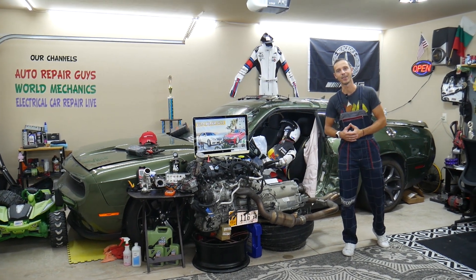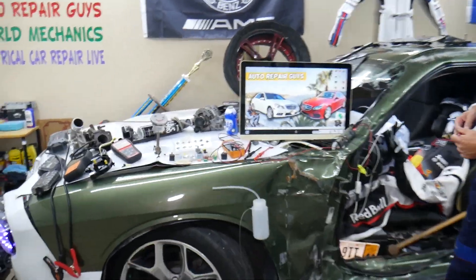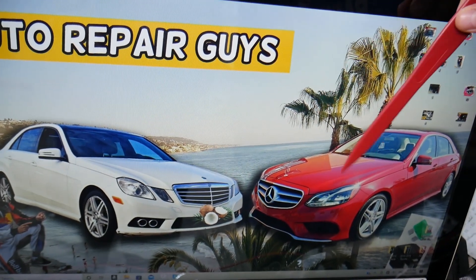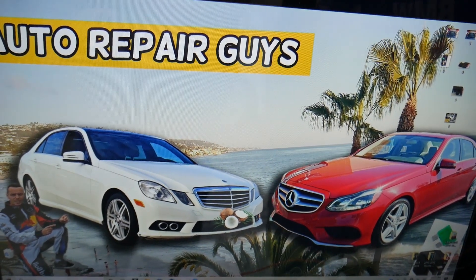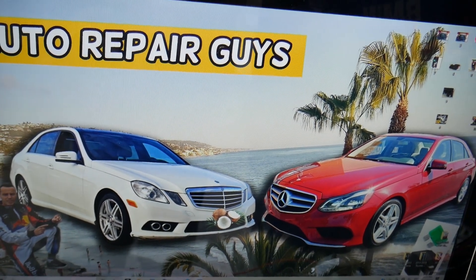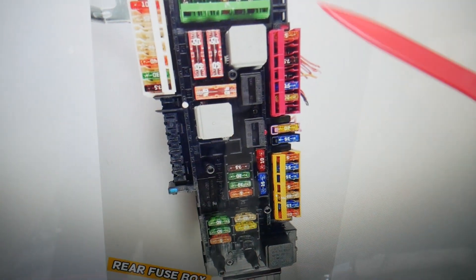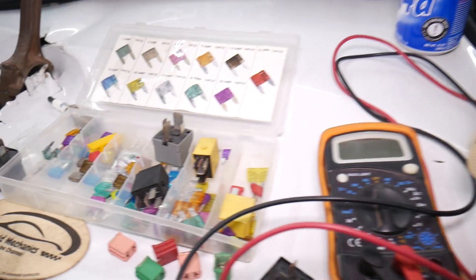Now, for the diagnostic connector socket fuse — we'll demonstrate on this generation Mercedes E-Class. This is the pre-facelift model, and this here is the facelifted model. Practically they're the same generation, so the fuse boxes are the same. You have multiple fuse boxes, but today we'll work in the one in the trunk. Open the trunk and on the right side you have a cover — pull that cover and underneath you'll find the main trunk fuse box, the rear fuse box.